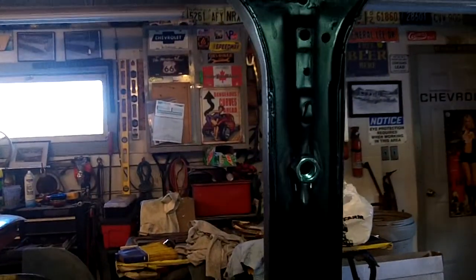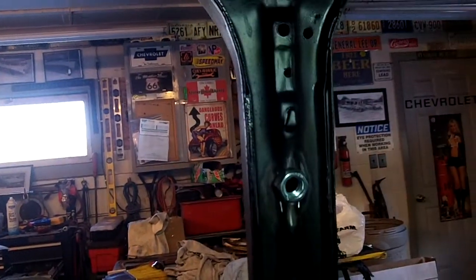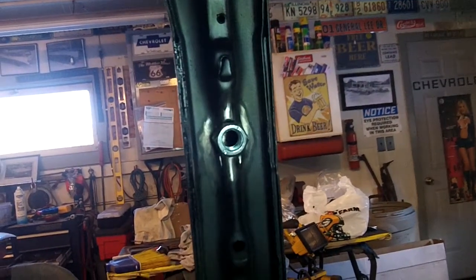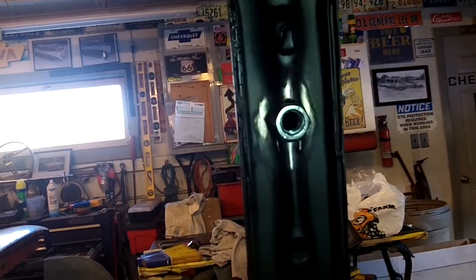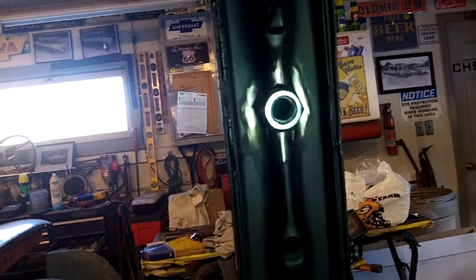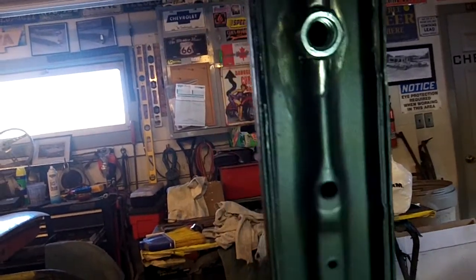So here's what I came up with. It's eight inches from this corner up here down. That's where it came out to be, and I marked it. It's got a nut that matches the bolt — the shouldered bolt that's in the D-ring that comes supplied with the universal seatbelt. I marked it, drilled an eighth-inch pilot hole, and then used a three-quarter-inch roto-broach. You could also use a hole saw to cut through this bead here.